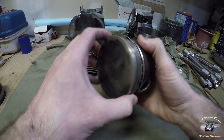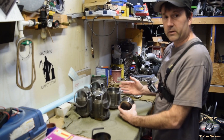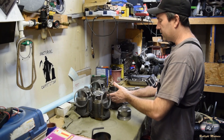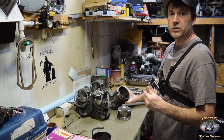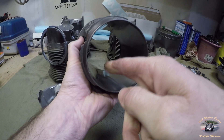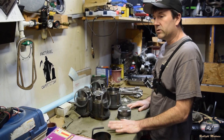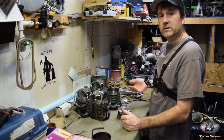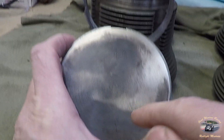What I normally do is oil the rings — this is already pre-oiled since I already had them in. I'll lightly use motor oil on the rings to help them slide down in there, then I'll take the cylinder and use a mix of pre-lube and oil on the cylinder walls — mainly to keep them from rusting, since it may be a month or so before I run this engine. Some people recommend not oiling the cylinder walls at all, saying it helps break the rings in, but I like to keep them from rusting.